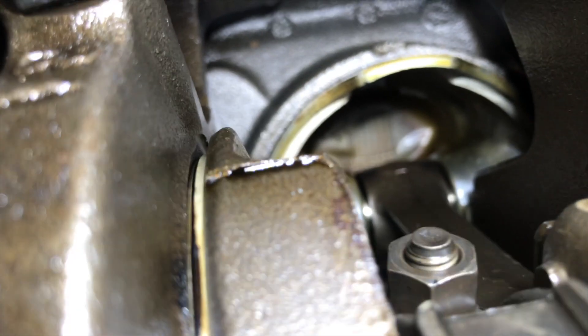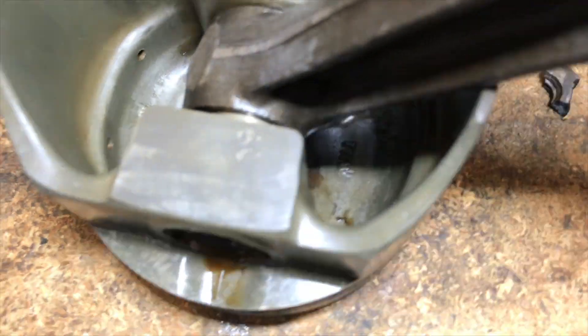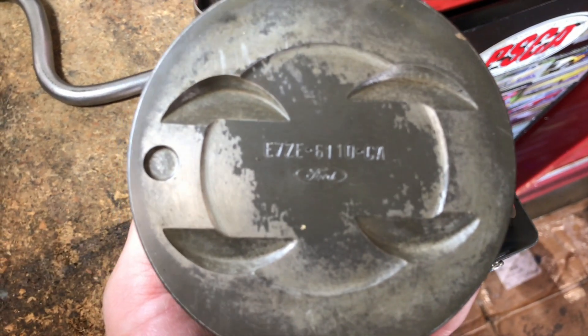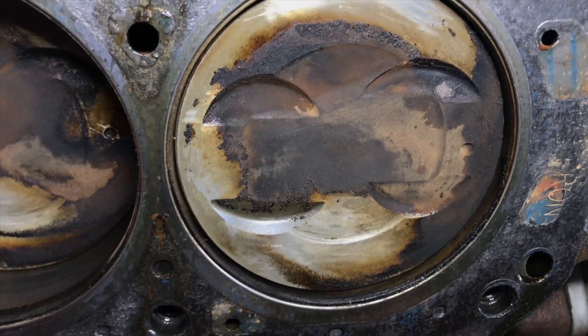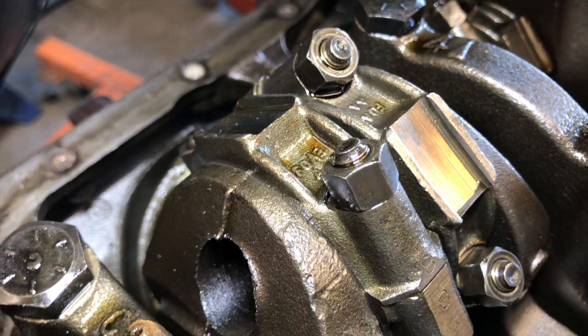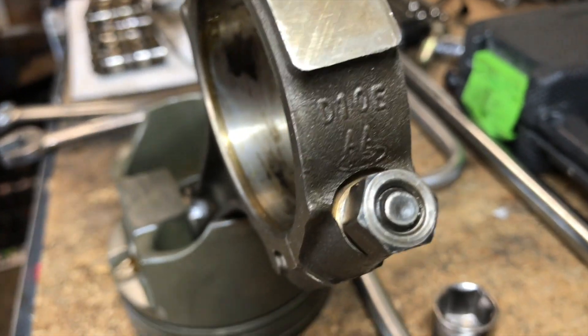Here's what I'm seeing: it looks like there's some casting marks down there on the backside of the piston. Now, the other set of pistons I've got from another motor, there are no casting marks there. In front of the piston there's the E7 part number. The pistons that are in my engine right now have no part numbers on them. For these balancing pads, they have a little bit different machining marks and they have an F0 part number, meaning they were 1990 part numbers. Whereas on these other ones, the backside is flat and they've got a D1 part number. You guys tell me what you think.